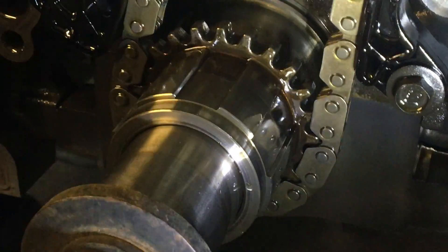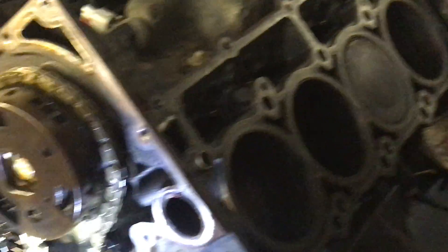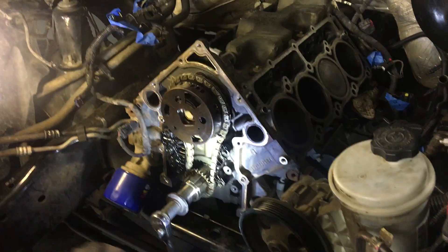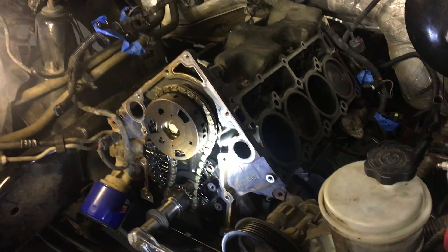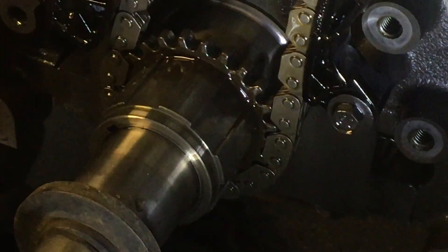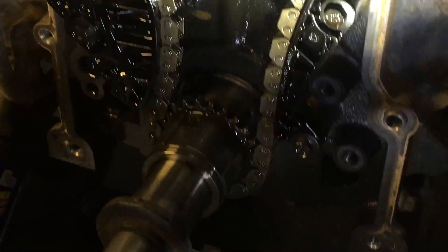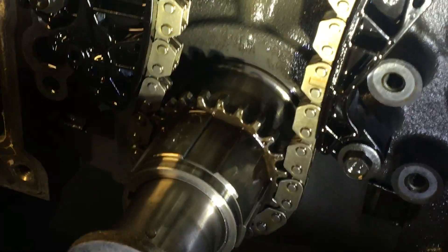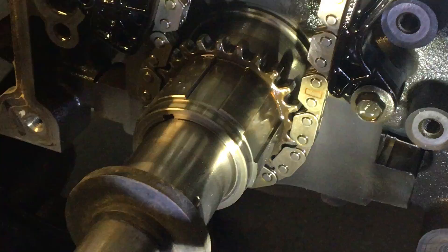If she shows you the motor you can see the pistons kind of going in and out and everything working. Keep your motor clean. Getting close — still no timing mark, so continue to keep it going. We're almost there. Still no cigar — maybe one or two more passes and that timing mark is going to line up. You can see the marked link coming down and we're going to be close — we're off by about one link, so that tells me we're close. One more rotation and it should line up where we want it.